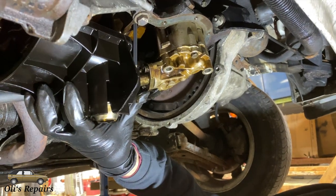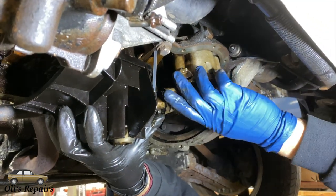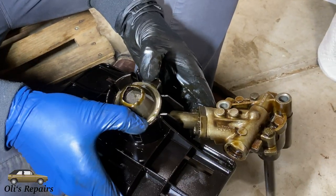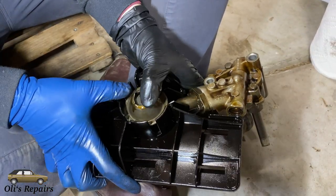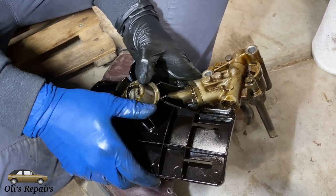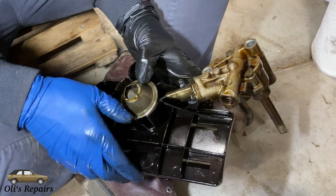Pull the oil pump straight out. You'll be able to see the little drive on the top right there, the little flat piece. Then carefully bend those clips backwards — this is brittle plastic. Take your time and then remove the plastic from the pump.